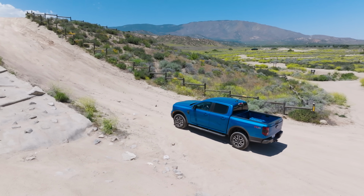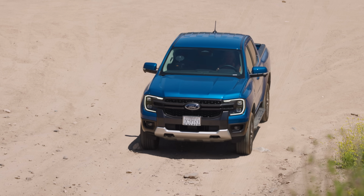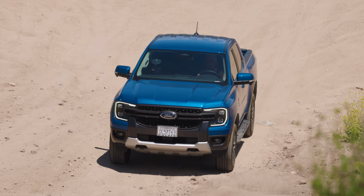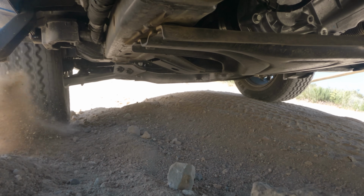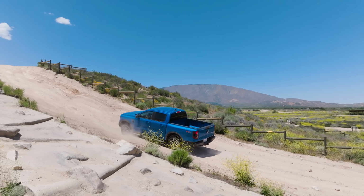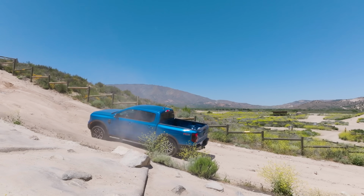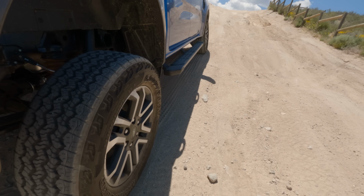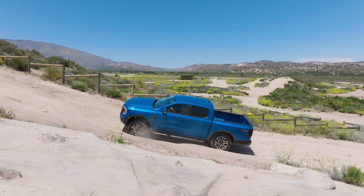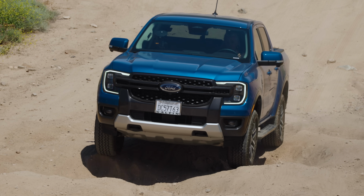All right, here we go in the Ford Ranger, same thing, appropriate off-road mode and four-wheel drive high, and I bet I'm gonna need to go into four low pretty darn quickly. We're gonna get a wheel up there, we're sticking, yep, right away, we gotta go into four-wheel drive low. Now, here's the thing. This has got a crawl ratio of about 48:1, but I only have 310 pound-feet of torque. But that better crawl ratio, come on, girl, come on. Come on, there we go, okay.